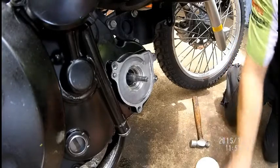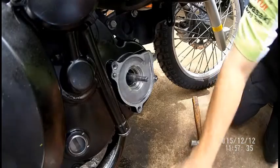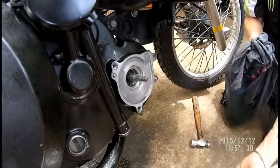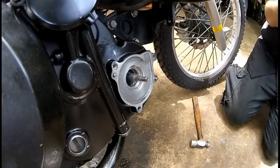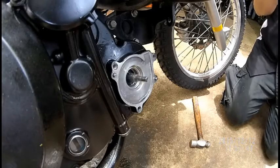Because what will happen is that this water pump mechanical seal will push it through anyway. Okay, that must go to Jimmy's. So you basically prime it into position. Yeah, but with lubrication, because you don't want to damage the lip of the seal and have that spring come off. Because then you've got to break this water pump seal to get to the oil seal, irrespective. So if you put the oil seal in wrong, you bug it.